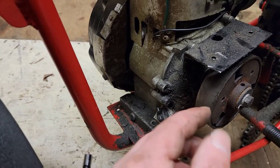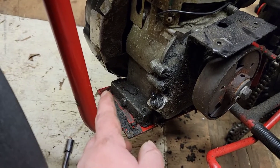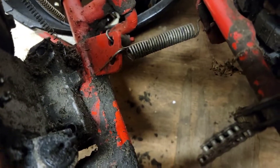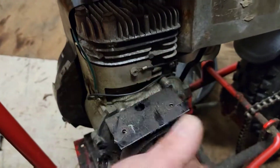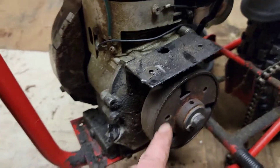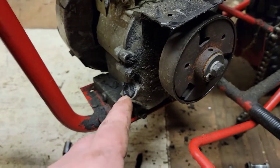Sorry about the noise of the heater, but it's cold outside and I want some heat in here. We got our bolts out — two in the front and two in the rear for the motor mounts. There's one right back in that corner and one right here. That's all that holds the motor on, and you can adjust it to tighten or loosen your chain. For now we're going to leave the clutch on — once I get it on the bench we'll pull this off; it looks pretty worn anyway.